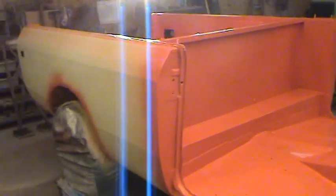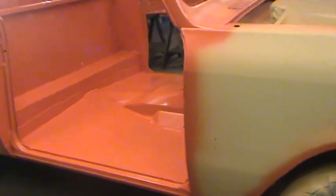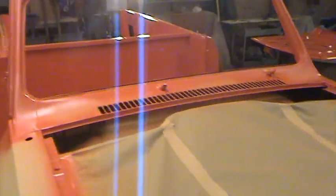Now these are the quarter panels, by the way, that we extended using Super Scout's 118 extension on the 100-inch wheelbase Scout II quarter panels. The extension piece I welded in and blended into the rest of the quarter panel, matched up the body lines. I've had some people ask about that — what kind of product it is and what's necessary to get that installed.